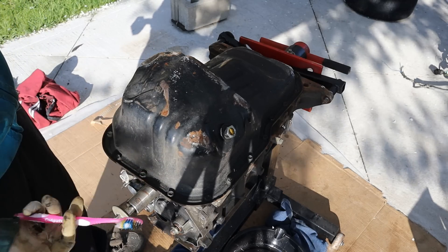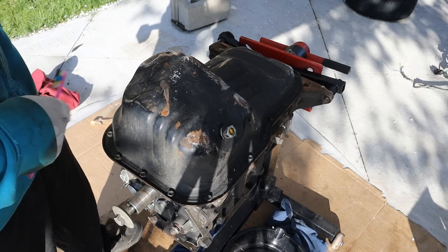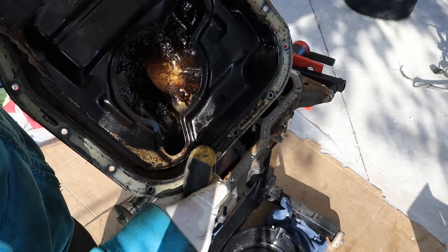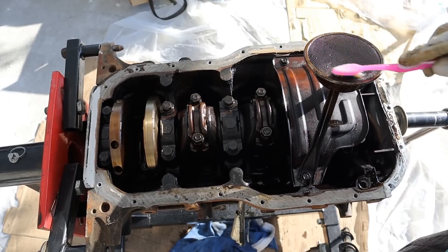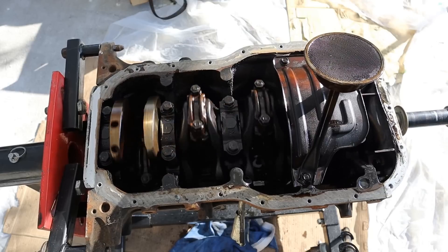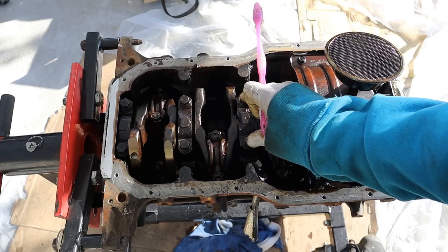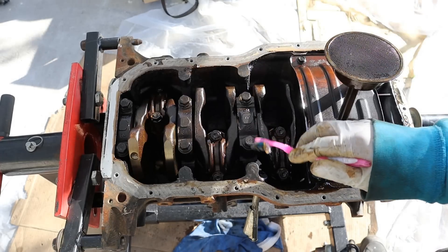Taking a look at the bottom of this engine, we have a stamped steel oil pan — this is before the days of cast aluminum or plastic oil pans — and you can see it's taken quite an impact without any leaks. I'll remove all the 10mm bolts holding the oil pan on. Looking at the engine from underneath, here is the oil pickup tube with a screen on it. The screen isn't too nasty from sitting. The engine turns over pretty smoothly without any weird noises. What I'm really surprised about is they're only using 2 bolts to hold the main caps on — many other vehicles use 4 bolts or cross-bolting.